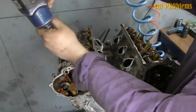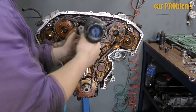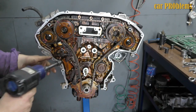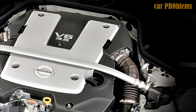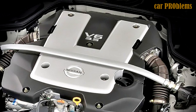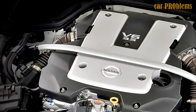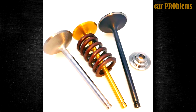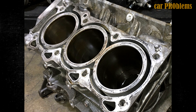In practice, the engines last much longer than 60,000 miles before they require valve adjustment. The timing chain on the VQ35 is fairly dependable. The firing order for the VQ35 is 1-2-3-4-5-6. The engine was upgraded and given the VQ35HR moniker in 2006, primarily applied to Infiniti. This new engine has variable valve timing systems on both the intake and exhaust camshafts, uses larger diameter valves and reinforced valve springs, and the cylinder block's height and rigidity were increased.